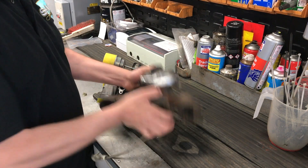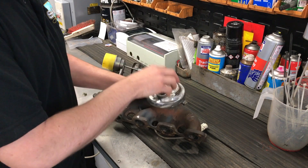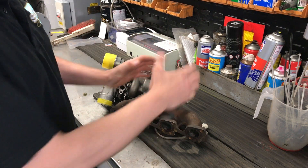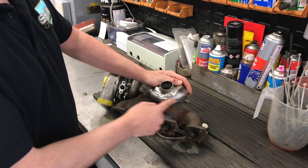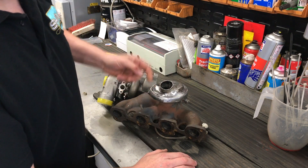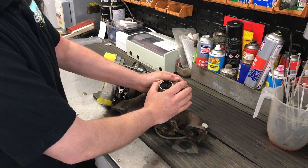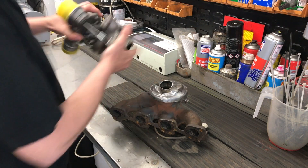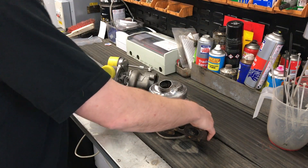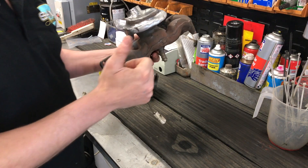The manifold's done. I have got to blank off and remove that. Obviously we've used the original manifold. I did have to weld to cast so I made sure it was extremely hot and I welded round it three times. Then I capped it off with a round cap and welded all the way round there and all the way round the side, which just gives it that extra strength. Because cast isn't majorly strong to weld with, but with that all in there that's solid. Then we've got the flange to go on top where we need it. Absolutely buzzing with that — it's worked really well and saved a lot of time over having a manifold made. Happy days, job well done.